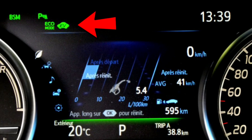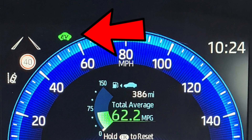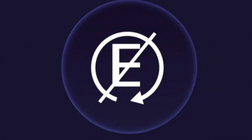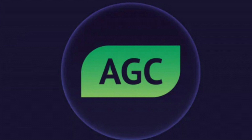Hybrid car EV operation indicator: this light lets the driver know that they're running on electric-only mode. You should continue driving normally, as in a hybrid this is the most economical mode to drive in. E mode crossed out: when the letter E is crossed out, this means that electric mode is currently unavailable for driving. This can happen because of more aggressive driving, like putting the pedal to the metal to gain speed on the motorway — the car's electric power can't recharge fast enough to let you switch to E mode. To return to E mode, you can slow down and wait for the electric power to return.